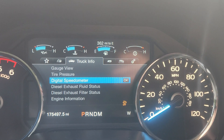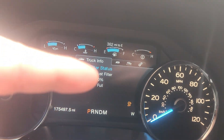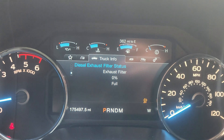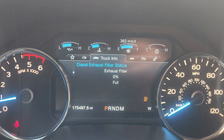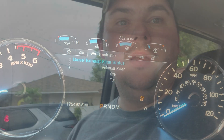So if you're getting close to home and you don't want your truck to regen, turn the regen off. Now we'll go over to the truck information, and you'll see a new bar underneath your exhaust fluid — this is going to show you the DPF level. Since this truck doesn't have a DPF, this one's zero obviously. But once this hits 100, it will give you a little prompt asking if you want to regen the vehicle, and all you have to do is press and hold OK, and the vehicle will do a manual regen in your driveway. That's how you turn on the OCR function on your F-150 diesel, so you can clean that DPF and keep up on it. Make sure you're not over full, and make sure it's not running when you get close to home so you don't stack more regen attempts causing a check engine light — which you don't want, because then you've got to call me, and I'm already busy enough when it could be avoided just by using this button.